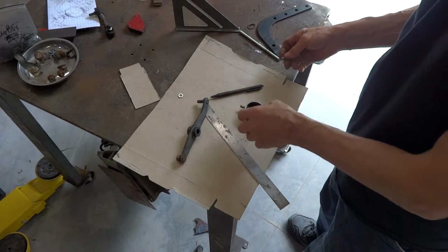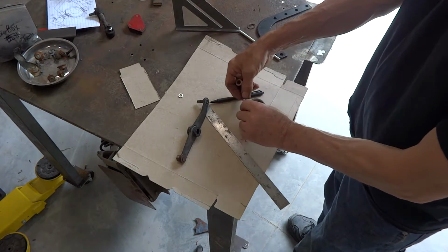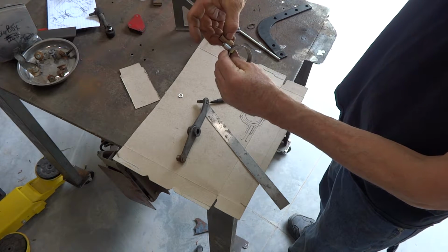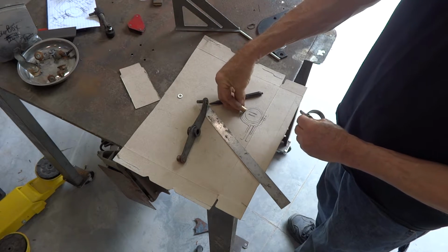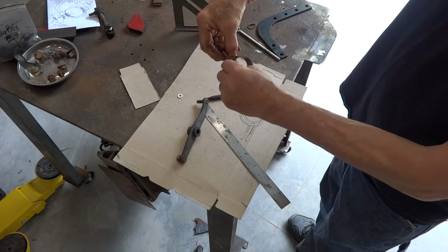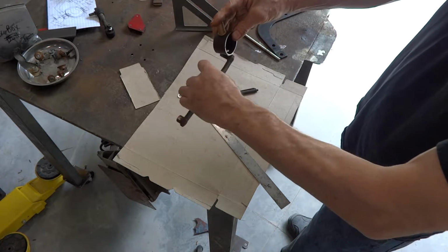There. This bushing will go on here, not on top of that. That bushing is going to get cut down a little bit. This bronze bushing will be turned down. It will go into the frame. This will pivot, allowing that cable a little bit of room to move around as the arm moves through its travel.